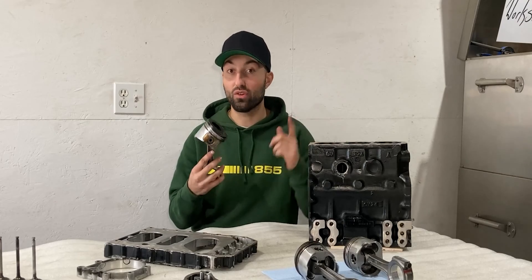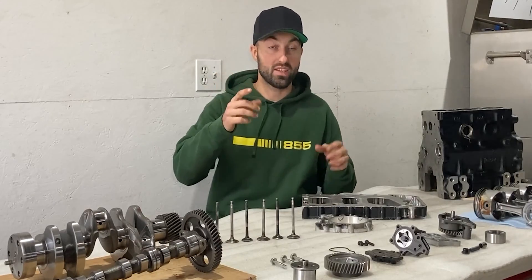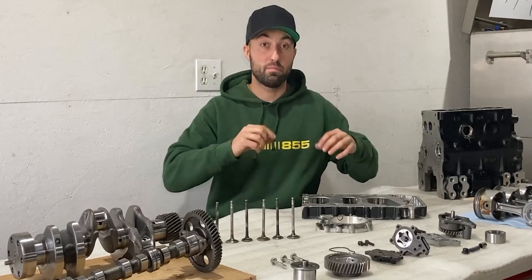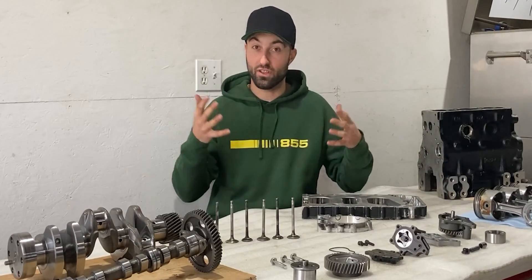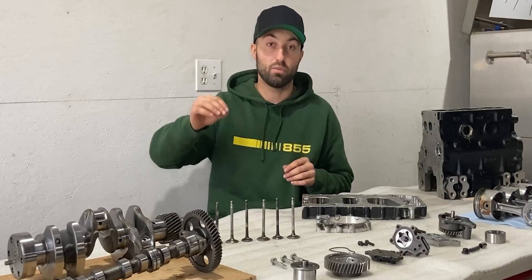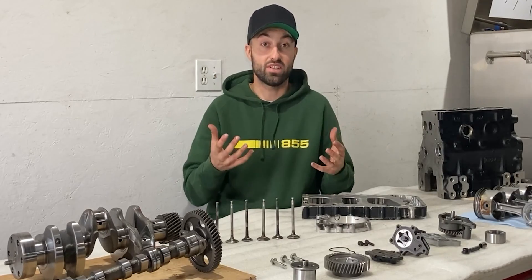I'm not exactly sure why this is so heavily worn — if you guys have any ideas drop a comment down below. At the beginning of this video I mentioned I want to share what happened with this engine. I'm not exactly sure what happened with the engine block or the pistons, but it could be due to insufficient oil supply. Looking at all these smaller parts, there are small flaws but those add up to become a bigger issue once your engine is assembled. At the end of the day I think it just comes down to poor craftsmanship by the previous mechanic. There are welds on the cover, damage on the small cover, damage on the idler bearing, and high spots on the bearing journals of the crankshaft. Adding all that together could cause a major engine failure — I'm probably lucky I didn't just start it up to see if it runs.